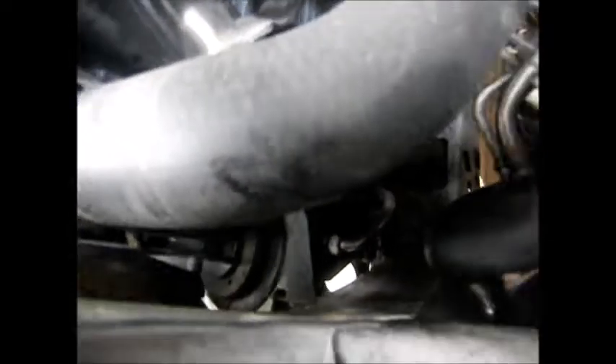It's probably not the fitting — I put that fitting on, it worked fine, no leaks there. It's probably going to be that hose because that hose almost does like a 90. It's a short hose. I heard that these GM hoses are notoriously leaky. It's way down there and it's hard to get to with a wrench. In order to check the tightness on that thing you might be able to get to it through the bottom, but it's almost impossible to get a wrench on it from up here.